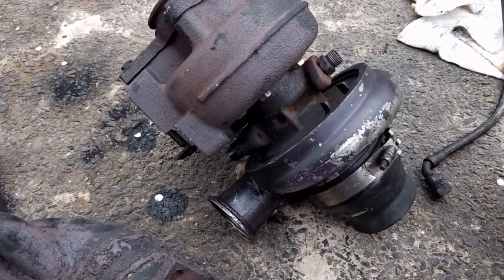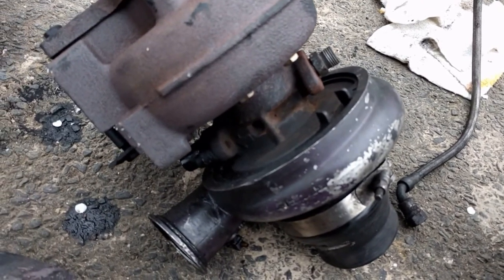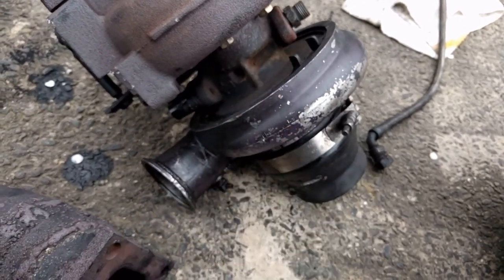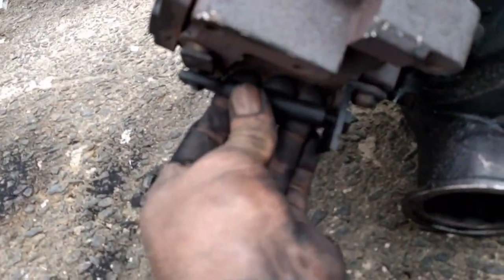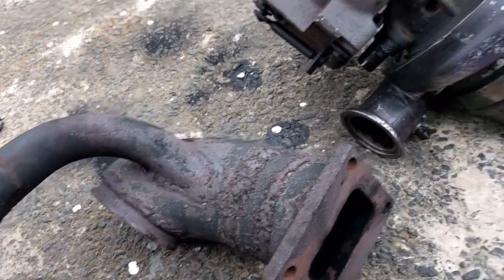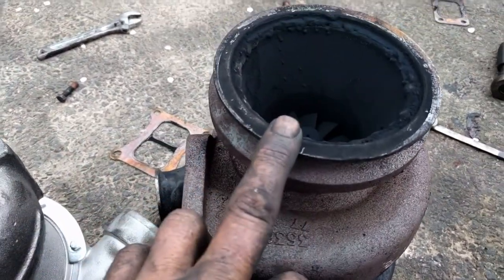These clips are terrible — I would try to stay away from anything that has a spring clip just for your own sanity. The spring pops out, the clip pops out, you can't get them back in — you'd be fighting it for an hour. This is also an internal wastegate. I just put a little piece of angle iron, drilled a couple holes, and screwed it shut — relying on my external wastegate instead. I could not get enough pressure relief from the internal wastegate, so that's why I went to an external.